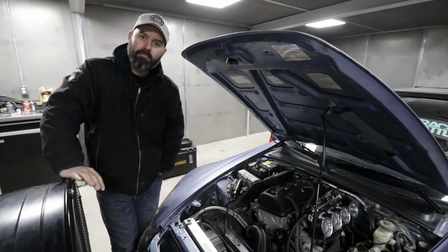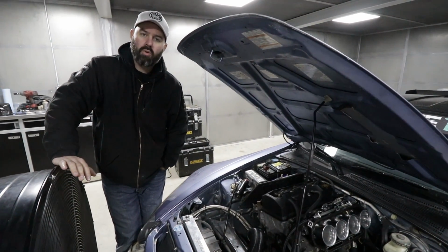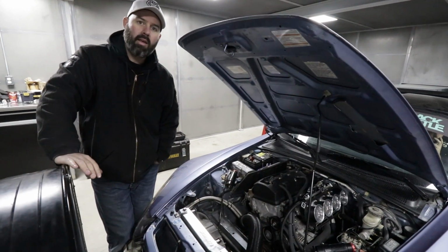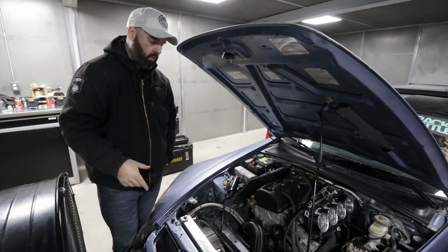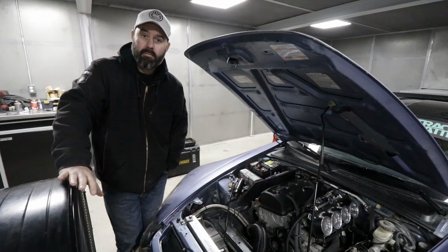Well, and even worse, because we'd be getting even hotter air. Today's like a cold day. It's true. In the dyno here in the middle of the summer. I'm thinking we were probably under 200 wheel easy. Yeah, it felt like it was down on power for sure when we were at Grid Life. So now we're going to put that airbox on there. We'll route cold air through the filter that we've set up here, and we'll see where we're at.